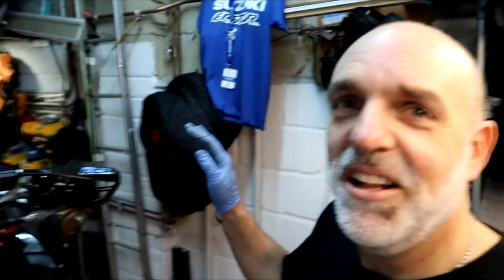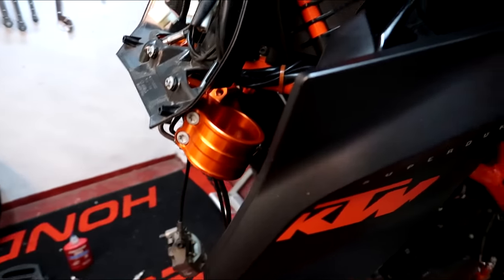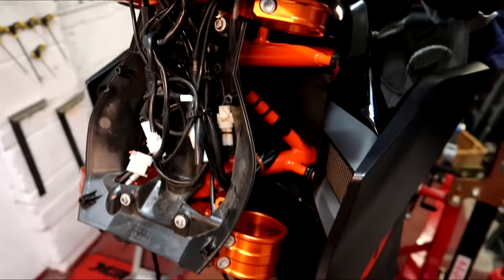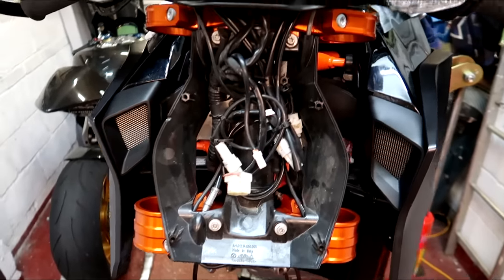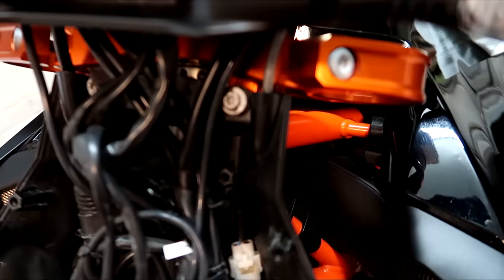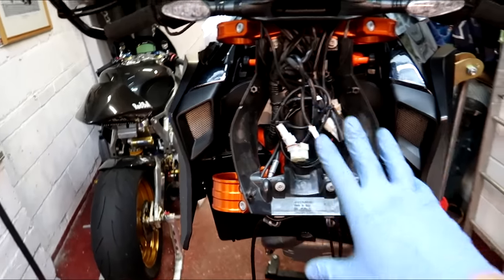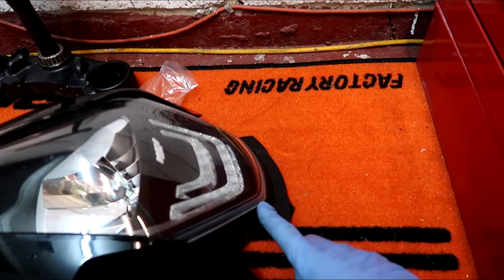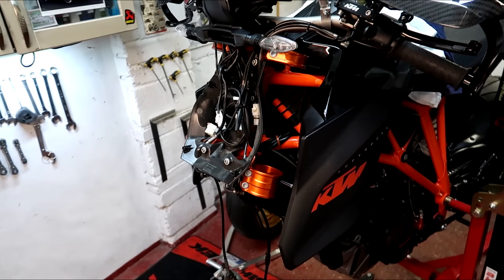Quite stressful! Look, she's almost back together now - looking absolutely sexy. I've got to tighten that top nut down and get the forks in. The top and bottom yoke have to be lined up, so the best way to do it is get the forks in first then tighten the top nut. I've properly tightened down the clamp - the little nut in there was loose, and that's what clamps the forks together. I've got plans for the headlight - carbon bits coming for it, carbon fins on the side, and the whole surround coming in carbon too. So we'll wait for those bits before putting the headlight back on.